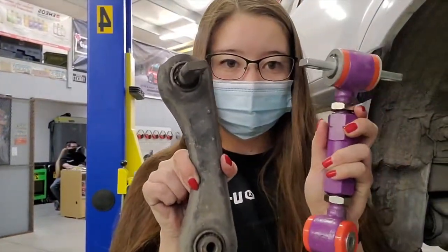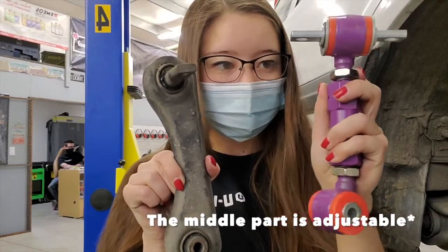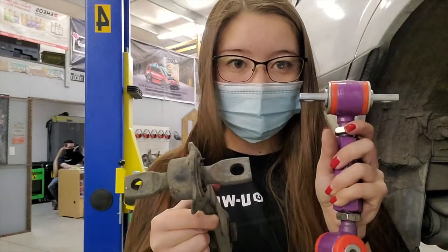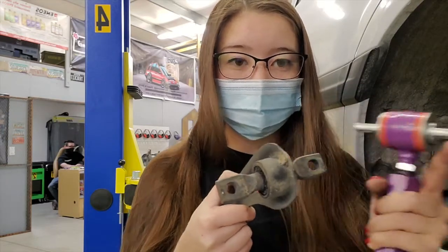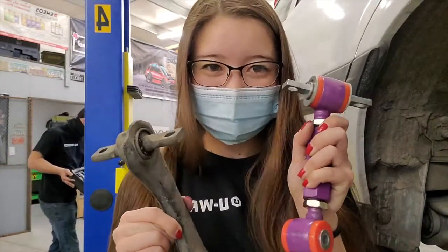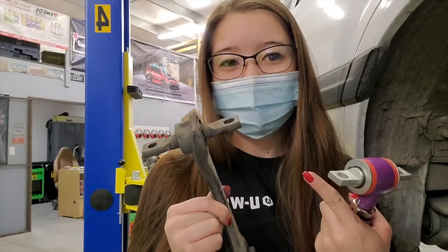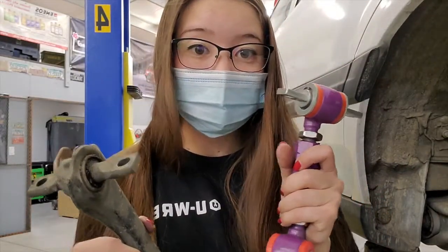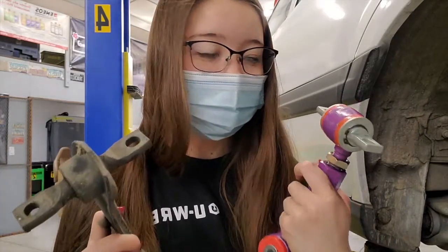Here's old and here's new. What makes these adjustable is these right here that turn - it can make it go longer or shorter. This obviously isn't adjustable, it has nothing to change on it at all. There is a way to get around that if you don't have the upper control arm replacement: you can get a few washers and do a longer bolt. It's not necessarily the best thing to do, but I know a lot of people do it. I actually did it to my old hatch. It works, it functions, it makes your camber adjustable, but it's really not the best thing to do. These are the best thing for you. If you need a quick fix to adjust the camber because you just went off on track, a couple of washers and a longer bolt wouldn't hurt for the time being, but definitely get these eventually. We're going to install the new ones now, then do the other side, get an alignment, and should be done.